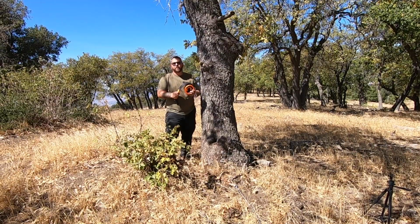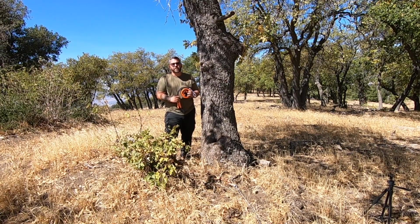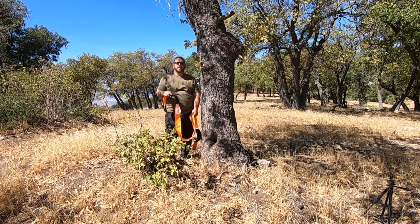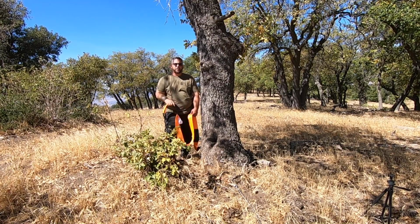Now, if you're winching off a tree, you always want to make sure that you use some sort of strap or a tree saver. This is a 3-inch tree saver I picked up on Amazon. I'll go ahead and put a link in the description down below. But you never want to choke a tree with your winch cable.